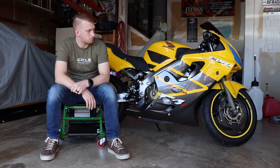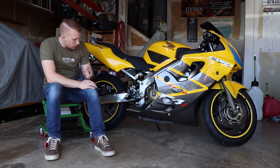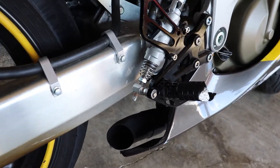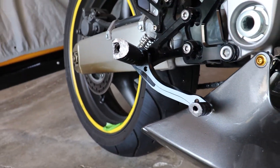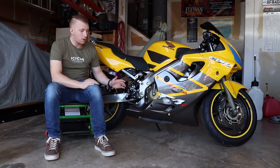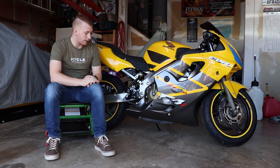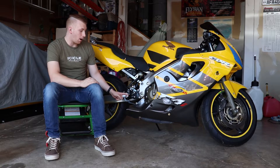One of the most important parts of racing is having good rear sets. What I did was purchase a set of no-name brand cast aluminum rear sets that were somewhat adjustable. Surprisingly, I thought if anything was going to fail it would be these, but they took the brunt of the fall — slid across the track, the bike did a rotation as it was sliding — and they did very well. They held up and I would probably get these again.